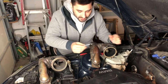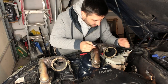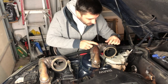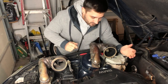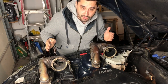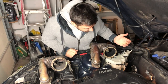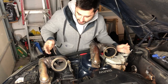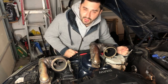I've also tried many other fixes, like one of those things that goes on the wastegate actuator to keep it under tension — it doesn't really do anything, it didn't fix my issue. I tried putting a washer in there too and that didn't fix anything either. So the actual and only solution in this case is to replace the entire manifold. These are not removable. I've seen some people use upgraded parts or weld this part in, but for under $150 why wouldn't you just put a genuine part in?